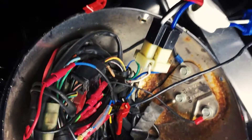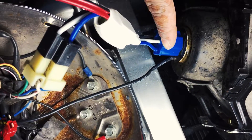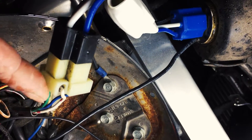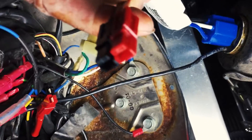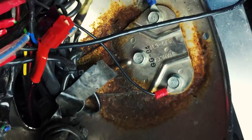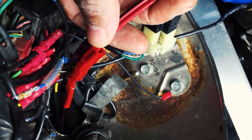The rain is really picking up here, but you can see I've plugged the blue side into the back of my actual headlamp, and the black end into the plug that used to go into the back of the headlamp — so I just stuck this in the middle. Now I've got this red connector that'll run back to my battery. I pushed the plug through from the back of the shell, and now I just plug that into the battery and connect the other end.